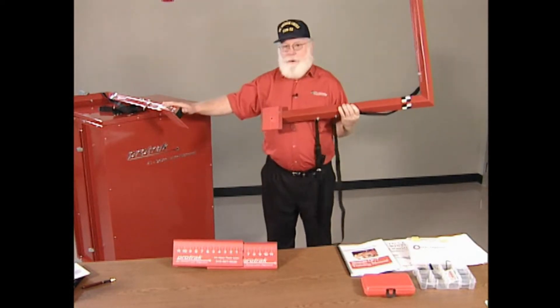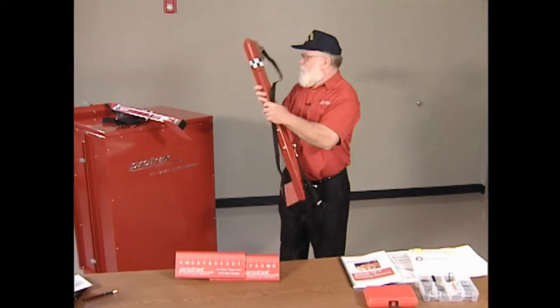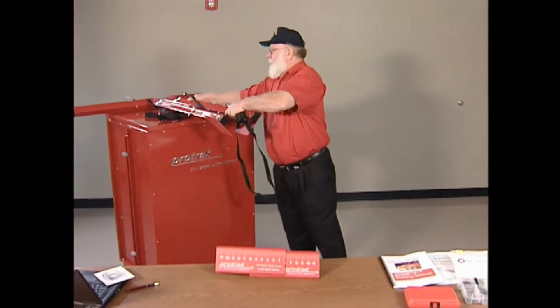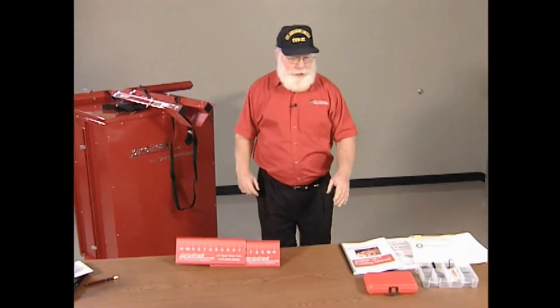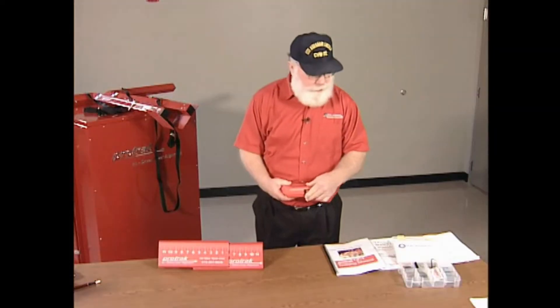The second bar would be mounted on the other side of the same axle — we box the axle. The system also includes a digital level that's used for measuring caster and camber, frame angles, driveline angles, and whatever. I'll show you how that's used.